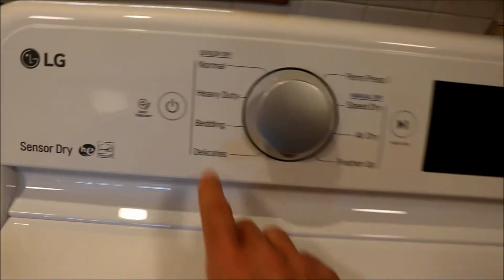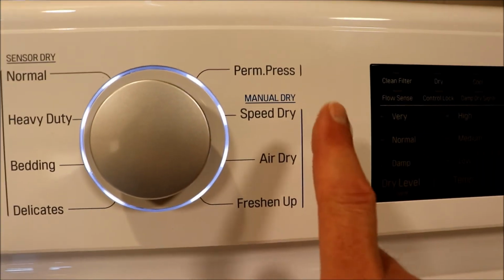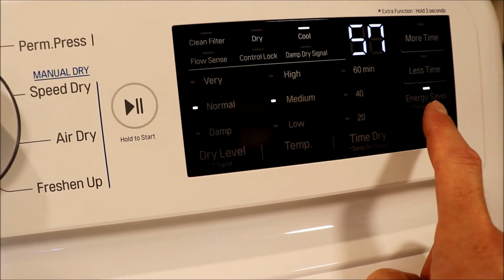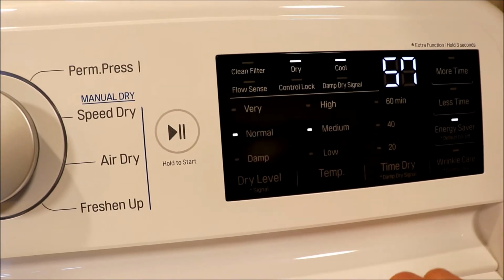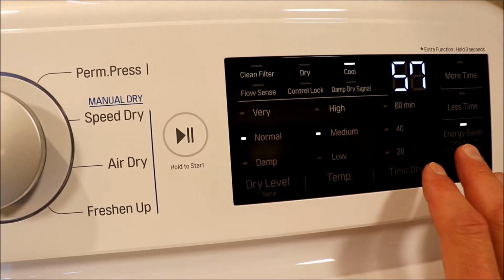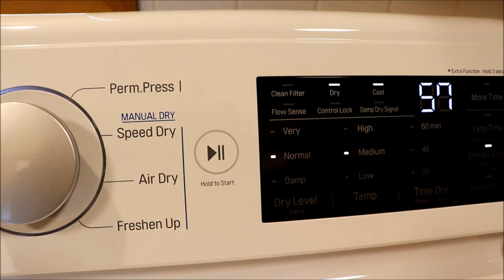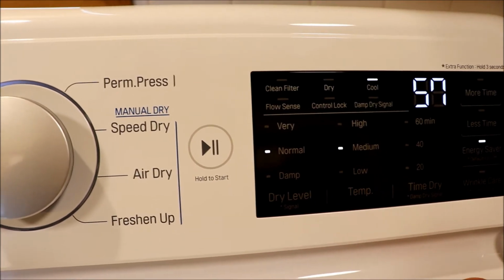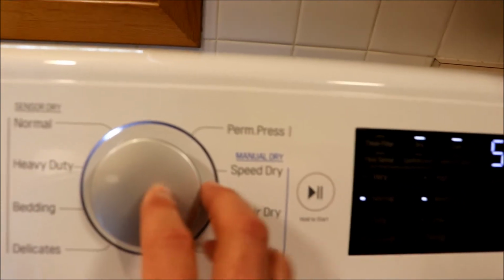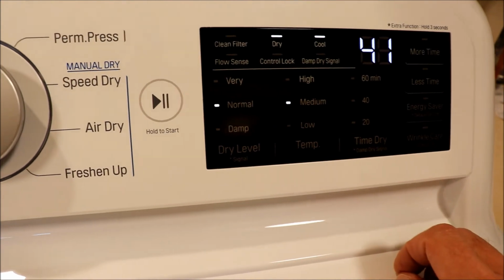And then to run the dryer, you're going to press power. Does the same little tune. Now for default you can just go ahead and press this, and when you do that you'll see this energy saver button lights up. When that comes on, don't expect your clothes to dry. Not after one cycle, 2 or 3. It puts zero heat into the actual dryer system, and you'll see here it says cool. It just doesn't do anything, and it took me a little bit to figure out why this brand new dryer was not drying our clothes, because I figured I could just do the start here, but that does not do it. So in order to do an actual normal, click it back into normal here, and then go over to this and tap it.